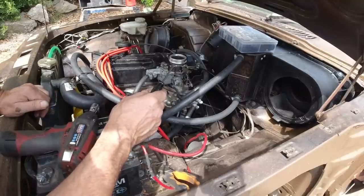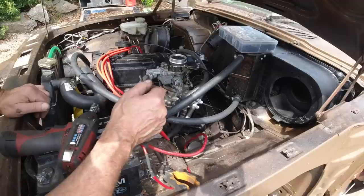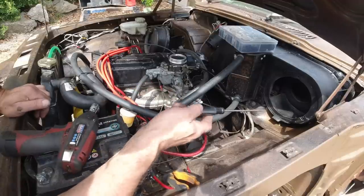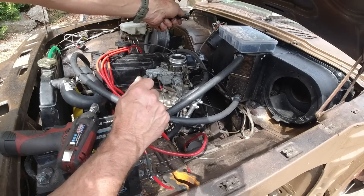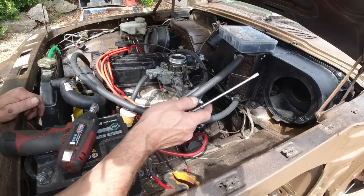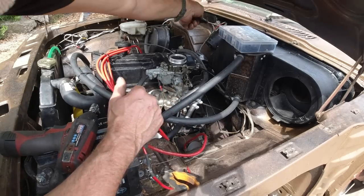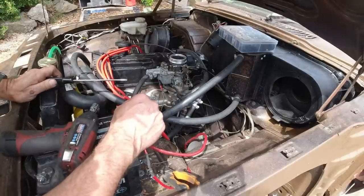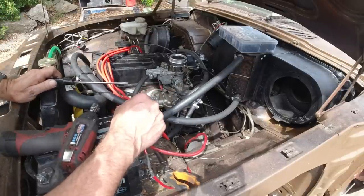Trying to think where I was up to last night. That's done. Oh, I'm going to seal the exhaust while the engine's cold. Got a fan to fit back in, and my wiper linkage blooming popped off. I'm going to have to take the bulkhead closing plate off, and I don't know what's happened there. I think I hadn't quite tightened the rotating arm bolt, the 10mm at the back, so I'll have to go and check that now. So everything else is done.